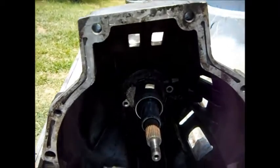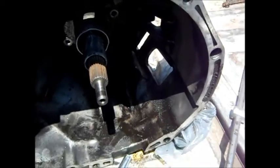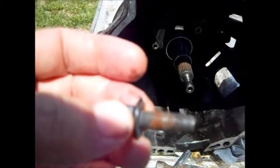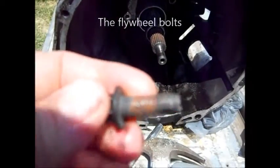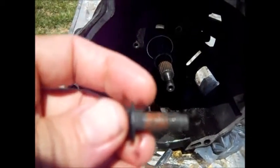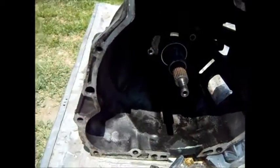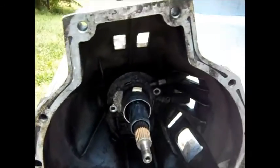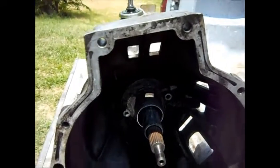So what I'm going to do is replace this, which I hope is not too expensive. As a side note, if you remember from video eight of my clutch installation series, I mentioned putting nut lock on the bolts to secure them so they didn't come loose. You can see this has a kind of a reddish tinge — that's the nut lock, and it was a bugger to get off, so at least it worked. This cylinder here is really stuck in place, so I'm going to work on getting it loose and then I'll come back.